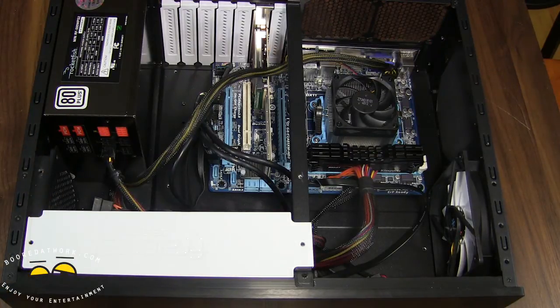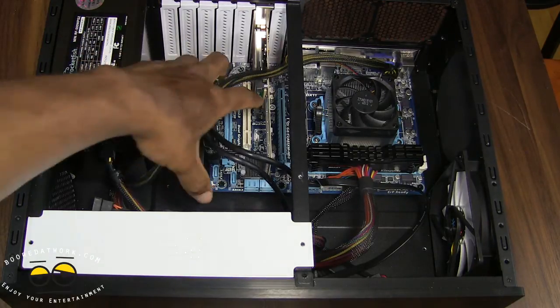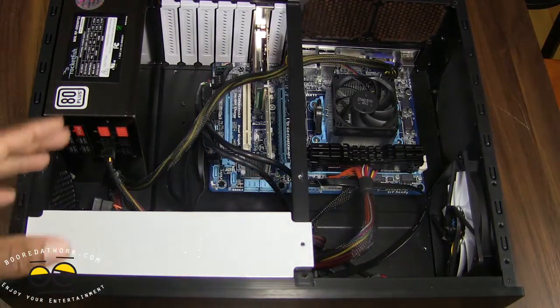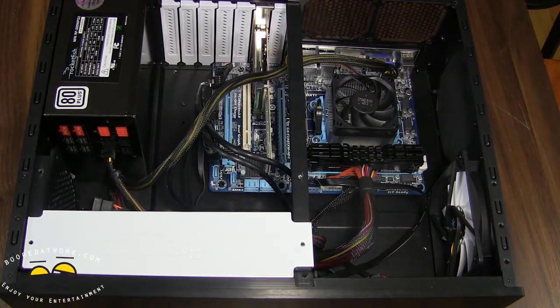Now, I can't stress how much I want a small footprint, both energy-wise and heat-wise, from this device. I want as few moving parts as possible. I want small enough parts that I can fit my hands in there without things getting too cluttered. As you can see, minimal cables, minimal devices. Maybe we'll put a graphics card in there later on and another SSD in here, but we're looking for minimal moving parts, because the less heat you have in your HTPC, the less you have to worry about burnouts of any parts. You have to remember this.